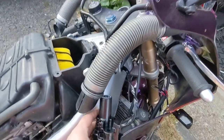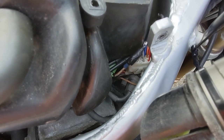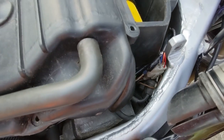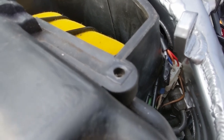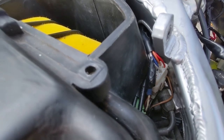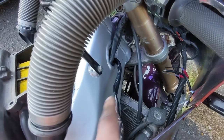I can't believe this. The trouble I had getting that white wire out. There has to be another way of doing it. I can't believe this - what a dickhead. I undo the connector, take off the earth wire. I wonder if I can pull that white wire through, cut it about here, put a new connector in here and tape that up.